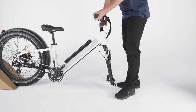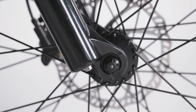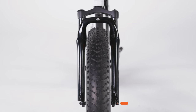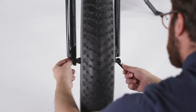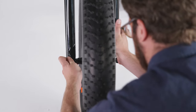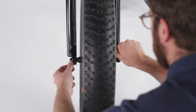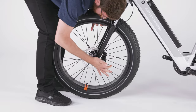Make sure you don't squeeze the brake levers. Carefully lift the front of the bike and lower the fork onto the wheel so the brake rotor enters the brake caliper and the axle rests on the fork dropouts fully. Check that the wheel is fully seated in the dropouts, that the wheel axle is level and parallel to the ground, and that the wheel is centered. Then hold the quick release lever in line with the axle and tighten the thumb nut until the lever can stay parallel to the floor without being held. Use the palm of your hand to close the lever fully without touching the brake rotor. There should be enough resistance that the lever leaves an imprint on your hand. If the lever is easy to close, open the lever and tighten the thumb nut a bit more, then close the lever.